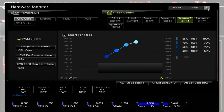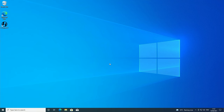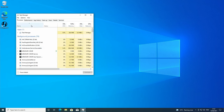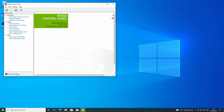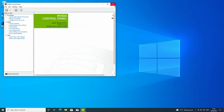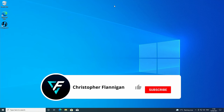Save all the changes — press X, X again, review the summary of changes, and click yes. The PC boots back into Windows. First check that RAM is running at the correct speed: right-click the Windows icon, click Task Manager, more details, performance tab, then memory. We're running close to our 3600 MHz target. Then check Resizable Bar — click NVIDIA settings, agree and continue, click System Information, and we can see Resizable Bar has a yes next to it. Do remember to check out the full case review — you'll find a link in the description. If you found the video useful please give it a thumbs up, and if you're not subscribed please hit the subscribe button. Thanks for watching.